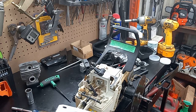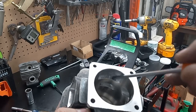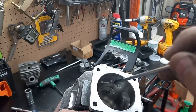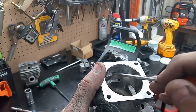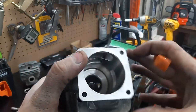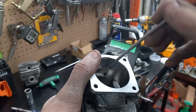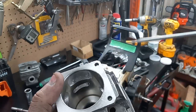You do get a good gain with the other method too — it's just a different feel. Then I came in here and took as much out as I could, thinning this web down on each side, and I also elongated them. You can see a dark spot back here — I didn't touch that back wall because you want that on an angle, so when this comes up it forces the charge to where you want it.